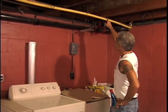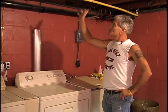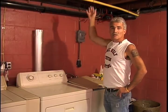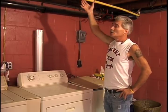Open rafters in a paint room. If you look up here, you'll see dust and dirt gathered on the boards. Open rafters are not good. If your house is 5 years old, 5 minutes old, or 50 years old, you're still gonna have the same thing. People walking across the floorboards, running, stomping, kids chasing the pets, vice versa, that dirt is gonna rain down onto your paint job. My suggestion, go to a lumber yard, buy yourself a sheet of Marlite and put it up, or buy some Visqueen and staple it up. This way you trap the dirt up here, you don't have dirt raining down onto your paint job.